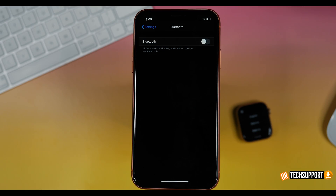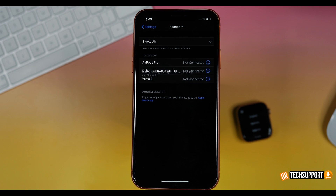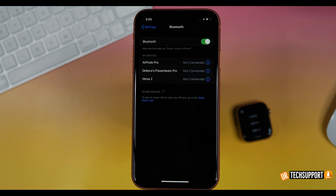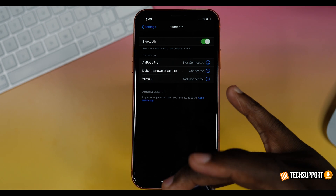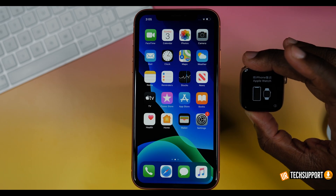The next reason is going to be your connections — and that is a technical term. The Apple Watch and iPhone need to establish a proper connection to pair, so Bluetooth and Wi-Fi are definitely something it uses. If either of those connections aren't acting properly, you can have a connection issue. First thing to do: make sure those connections are on before you pair. Make sure Wi-Fi and Bluetooth are turned on.